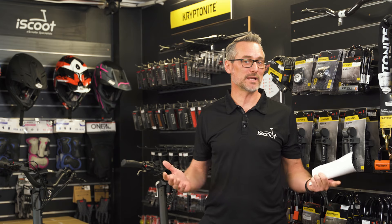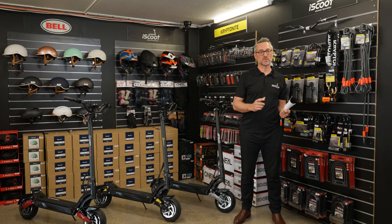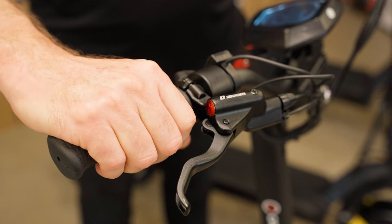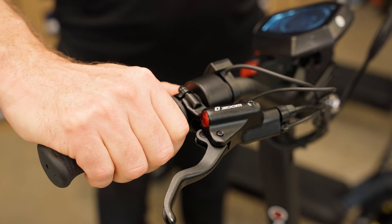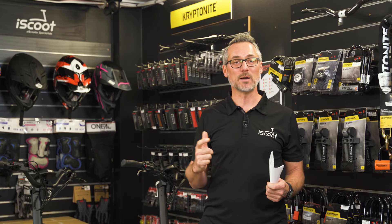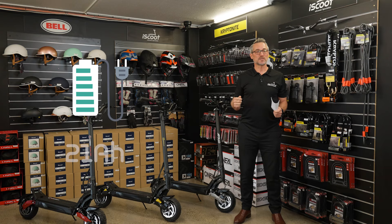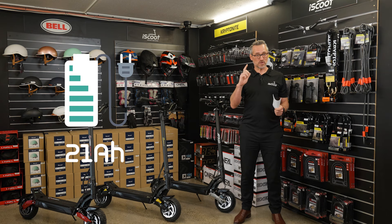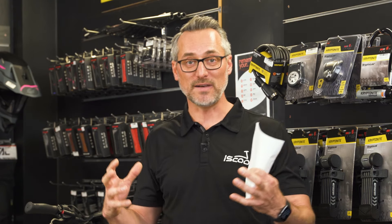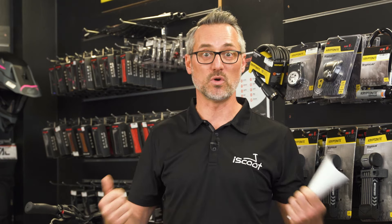Let's talk performance — that's why we're considering one of these scooters. All come with two controllers: one to drive the rear wheel and one to control the front wheel, both rated at 25 amps. All scooters also share the same throttle to control speed and relay signals to the controller. The V2 throttles across all brands have been upgraded, making them 25% more responsive. The batteries inside are 21 amp hour, and the controllers are 25 amp — that gap gives some flex to avoid damaging the battery from controller draw.